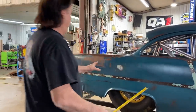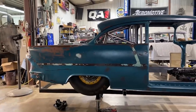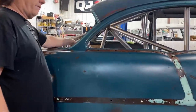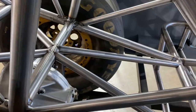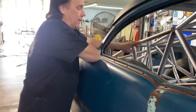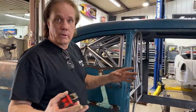So we're visually placing the wheel where we think it looks right, and that's perfect right there. I've got just a stock Ford housing in there right now, just for basic clearances when we're building this chassis. It's not in the center where it should be. It's 3/4 of an inch too far back. So there'll be a motor plate that's 1/4 inch thick that'll scoot the transmission back 1/4. Well, 3/4 and 1/4 is 1 inch.